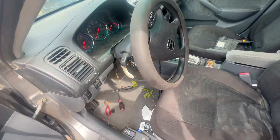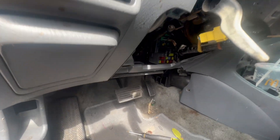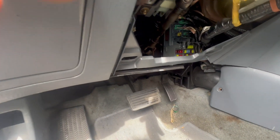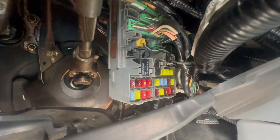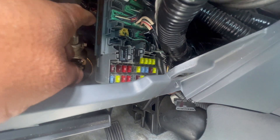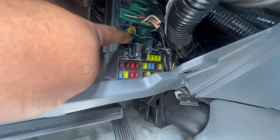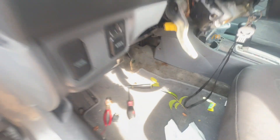I'm going to move my stuff out of the way so you can hear the clicking noise. I already removed the cover over here, so it should be easy to show you what's going on. You hear that? The clicking noise means the relay is getting triggered. So first thing you're probably thinking is the relay is bad, and it sounds like the battery is low. Let me go to the front.